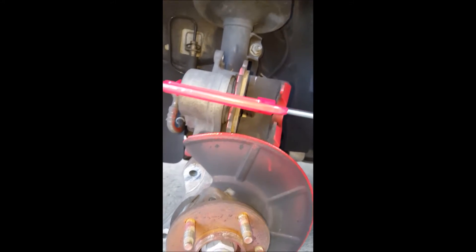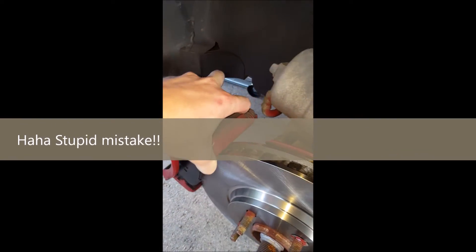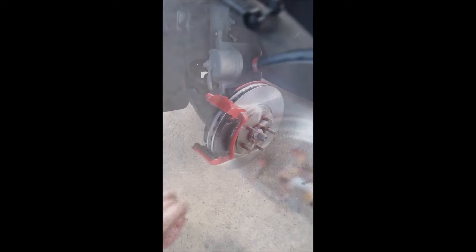That's all you do, then you'll be able to put the rotor on. Put this bracket back on and slide the piston right on over top. Put the rotor on, use the two clips and pinch them back on here. I'm about to remount this bracket — put some anti-seize on both of the bolts. It just goes on simply like this and mounts just like that.